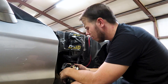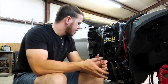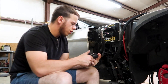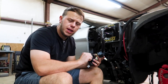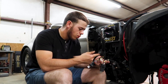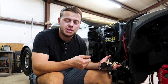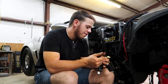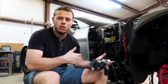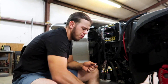I wonder if I should even keep these relays - should I just unplug them? I'm going to go ahead and mount them just because. Now that everything's pretty much in place, we're going to mount our relays. There's a relay for starter, one I don't really know what it is, reverse lockout - which I deleted my reverse lockout on my trans so I probably don't even need it - and fuel pump relay. Don't need that either because it's a mechanical fuel system going on the car. I'm not sure which ones I need but I'm just going to mount them out of the way nice and neat since I'm kind of OCD like that.